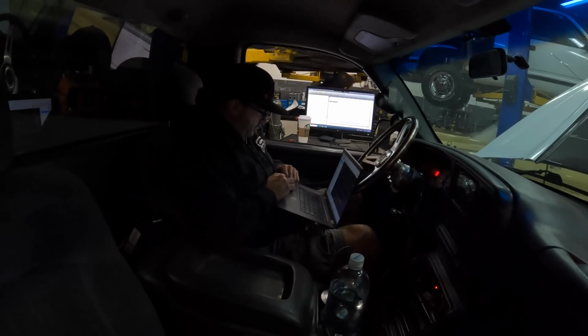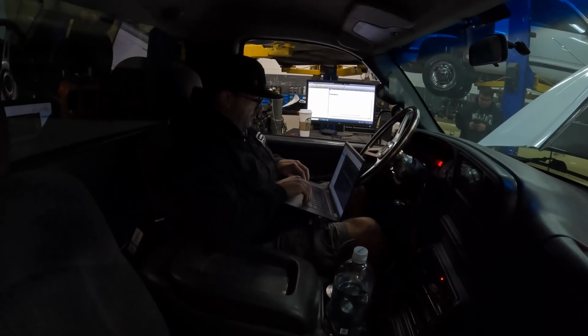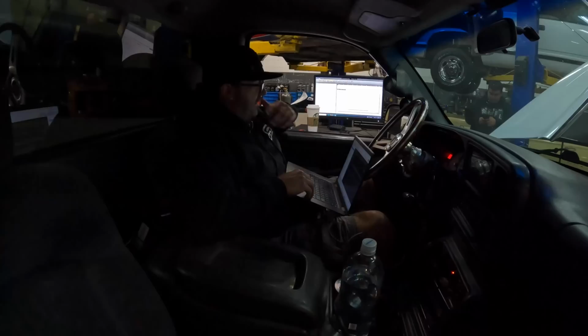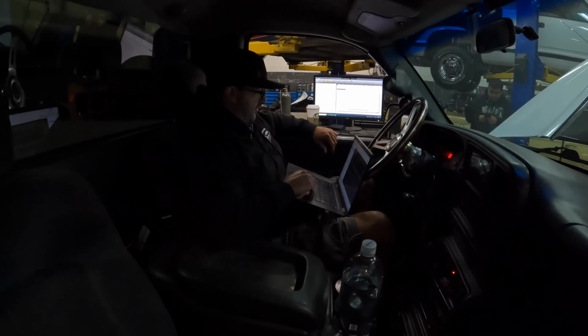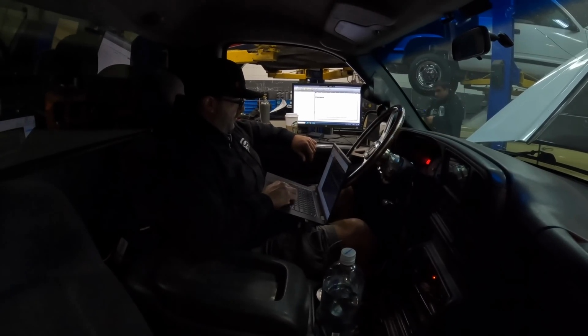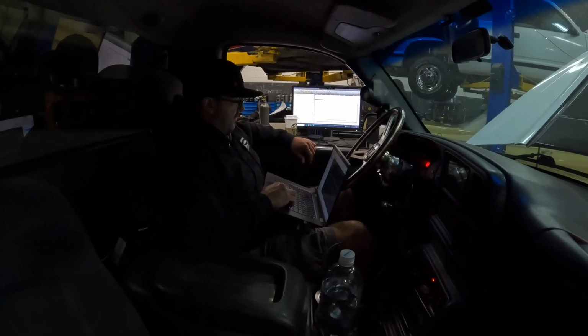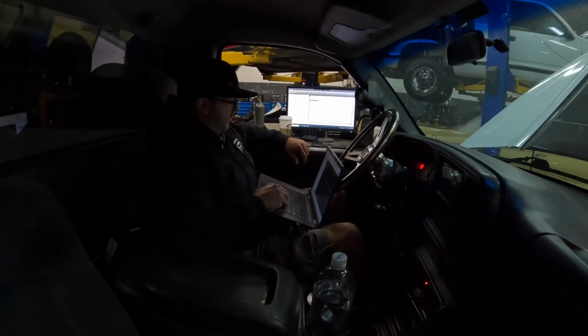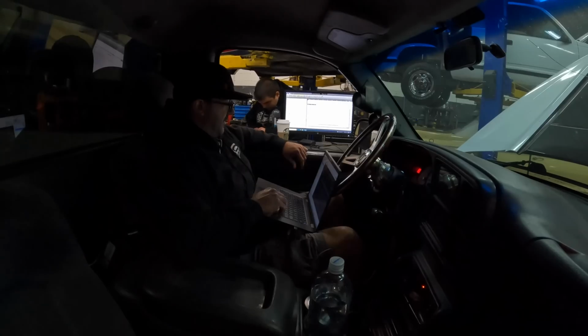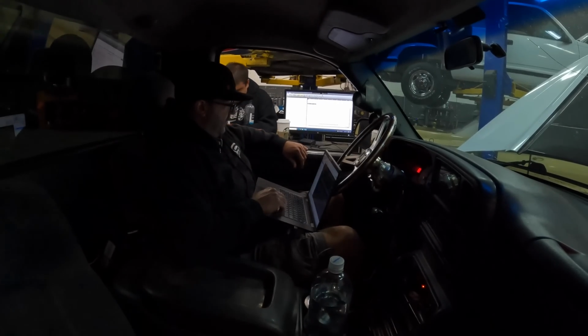I see it's very squiggly right there. Looks like ocean waves. But you said the converter's fully locking, right? Well, I unlocked it that time. There's a lot of slip in the converter. Like 700 RPMs of slip. So you said slipping at the converter? Yeah, for example, the RPM on the engine is 5,700. The trans input shaft is 4,900. So it's at 800 RPMs of slip.